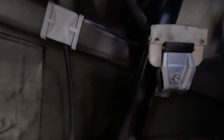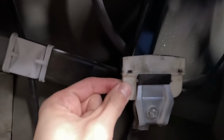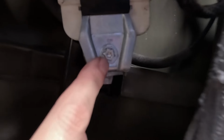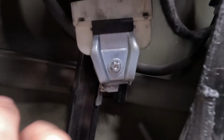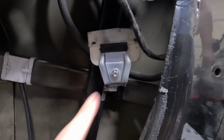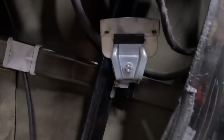And we're gonna have to loosen these, because they're probably clamping right now. This is supposed to come out with the window. And then same thing over here. Okay, so we'll get these out next. And so here you can either use a Torx bit or an E-socket. It'll grab around it, whatever you're comfortable with. I guess it's redundancy if one of them strips. We're just gonna use the E-socket because we have it.